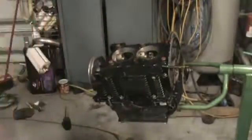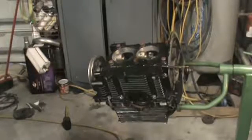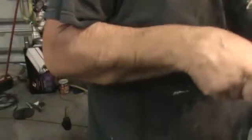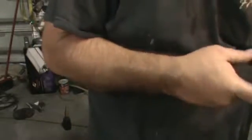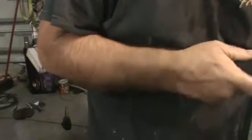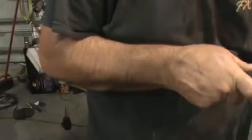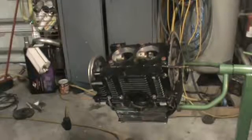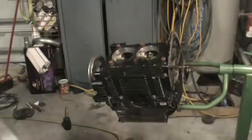Alright, now we're going to torque the 8mm nuts next. Putting the glasses on here again and see where this is set. You don't want to over tighten these. 18 foot-pounds is plenty. If you get too much more over that, you can stand a chance of pulling the studs out of the case. You don't want to do that, especially on the back ones there.